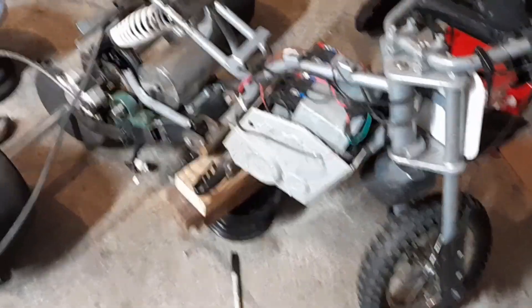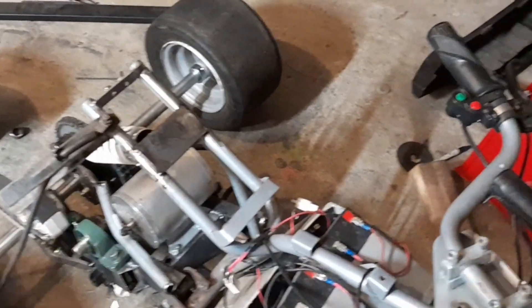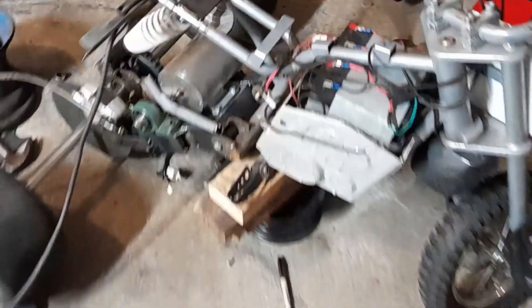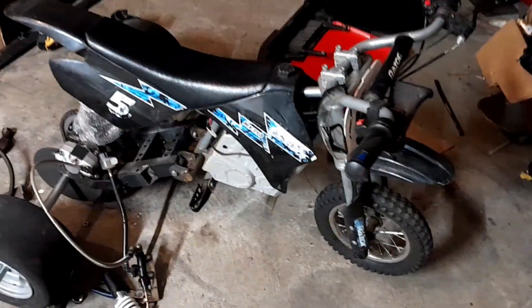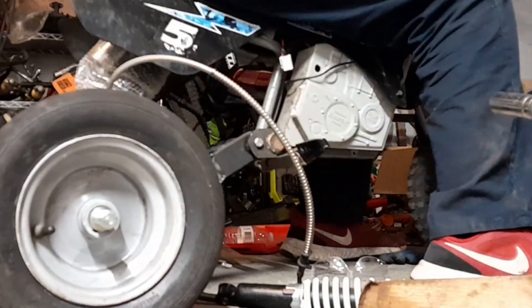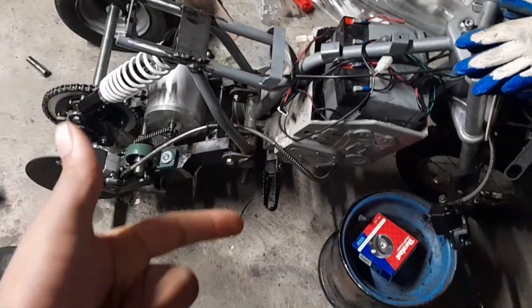Alright, so a lot of work has been done. Everything that's going to be on this thing is pretty much on it right now, except for the chassis. Right now where you sit is pretty weak - I will be strengthening it. But for right now I just want to test out how soft it is, hopefully I don't bend or break anything. Let's do a travel test real quick. Not bad, could be better. I got the chains installed, I ended up welding the sprockets on there. Now it's time to get the wiring done and the brakes done.